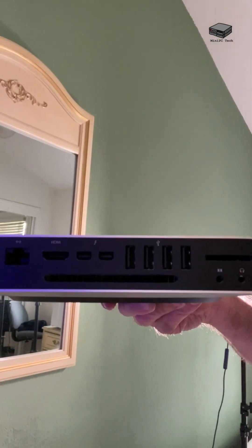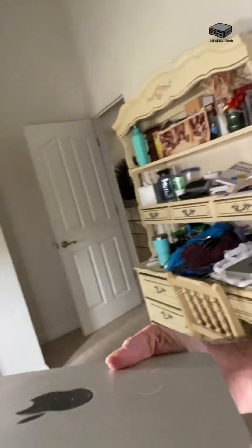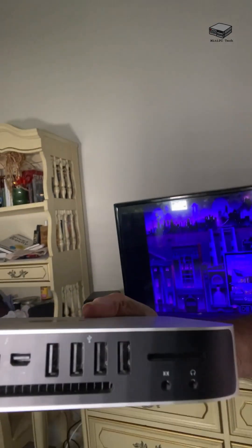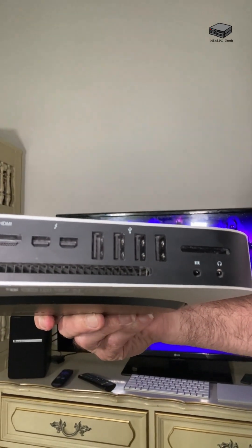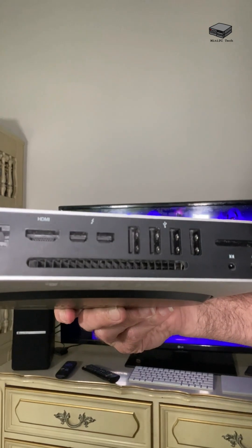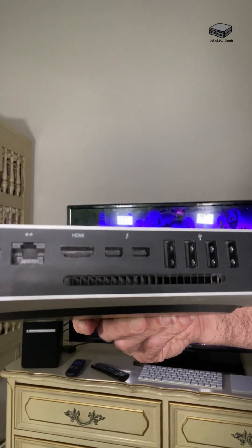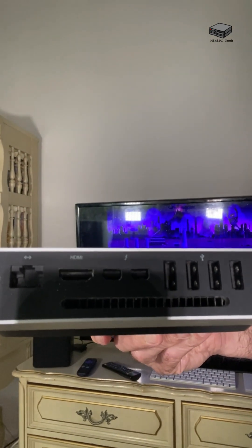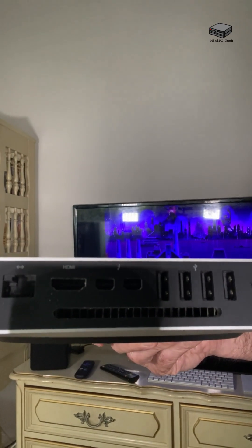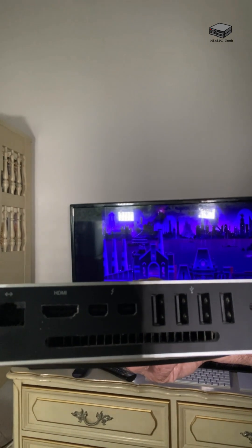I hope you can see it — this is an older Mac Mini that I'm using. There are four USB interfaces here, two Thunderbolt, and an HDMI. Now, you may think you can't do dual monitor on this, but you can, because with Thunderbolt you can use a hub and get multiple outputs, including an HDMI out of it.